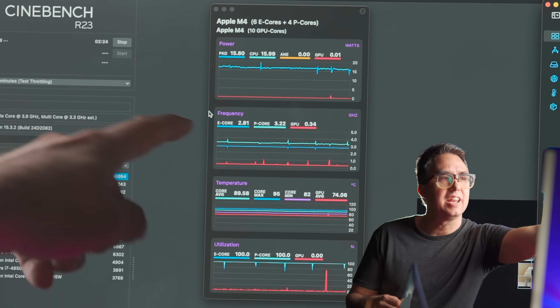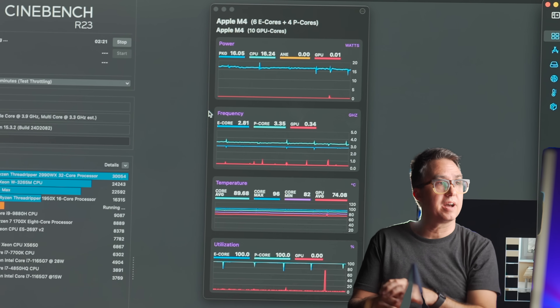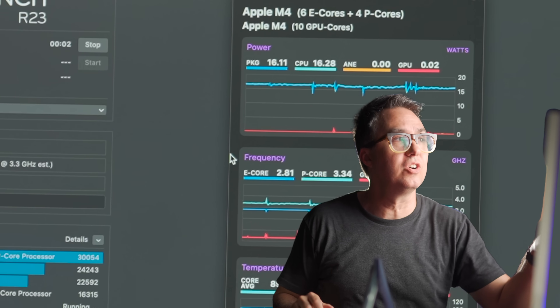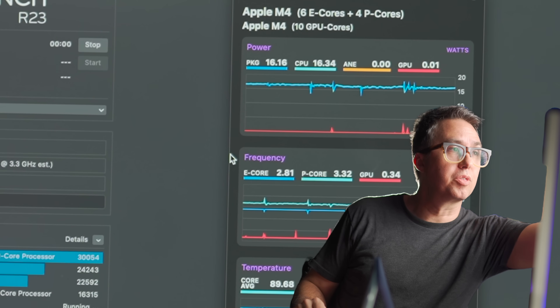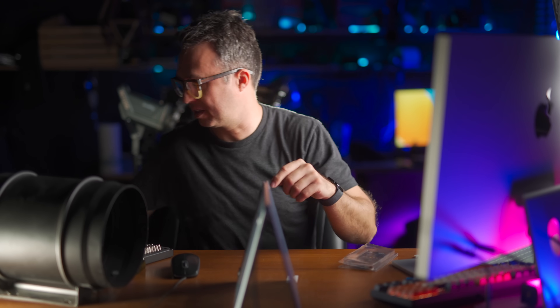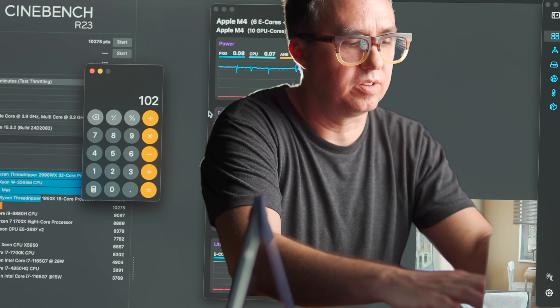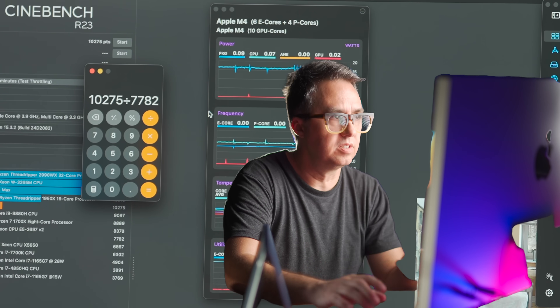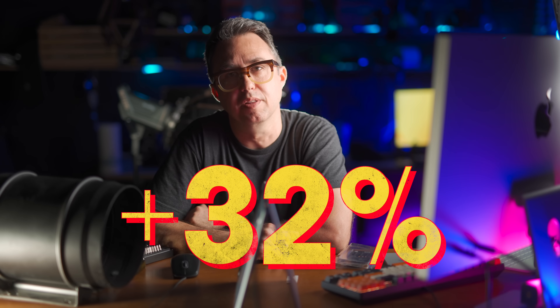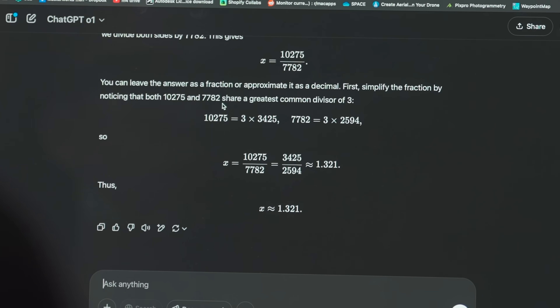The number to beat is 7,782. This is almost done. Moment of truth — 10,275. Let's do the math: 10,275 over 7,782 is a 32% bump. We got 32% more speed running the computer this way. 32% faster — we got a 32% increase in the speed of this computer by doing this. It will be faster too if you just run it on the table like normal, it just won't be that much faster, because this fan is blowing away a lot of the heat. If you have a problem with thermal throttling on your M4 MacBook Air, this is worth doing.